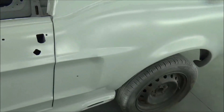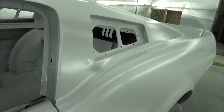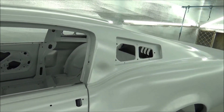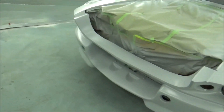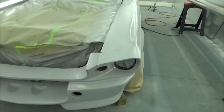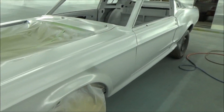I'm happy with the way everything fits - the line and the way it flows. There's something I did not notice - there's a dent right there. Had to be on the panel when we bought it because I know I haven't hit it. It's little stuff like that that really shows up whenever you get some sealer or some primer - whatever you use - that'll really help you find all your little bad spots. Now we need to get this thing untaped, get it back over to the first lift, and get back to doing some really fine body work.